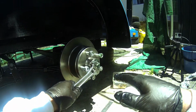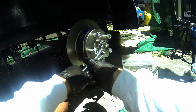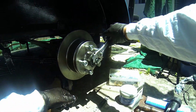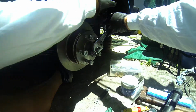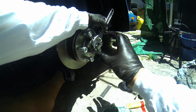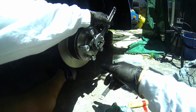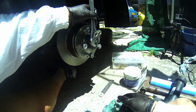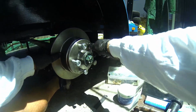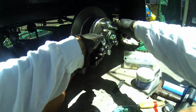Once it's completely tightened, okay, and you know that that is now being all pressurized inside, loosen it up a little bit. Now I like to do a 3/4 turn. There's a reason for that. Sometimes in some videos I've shown you, you just do it hand tight. Unfortunately, some threads don't allow you to hand tighten it. So a 3/4 turn back, maybe a little bit more. There you go. And I just check to see that the hub's not wobbling at all. There you go, make sure it's not wobbling, and that it turns nicely. There you go, that feels pretty good.